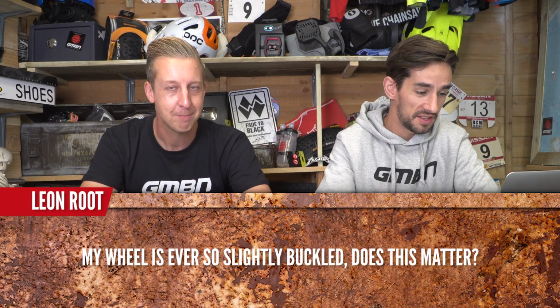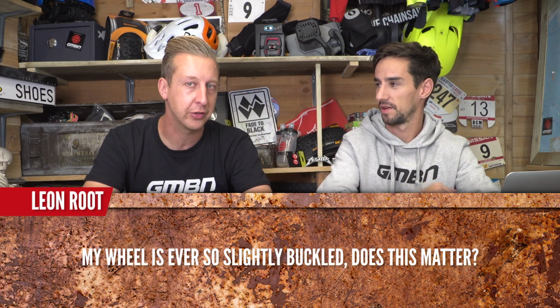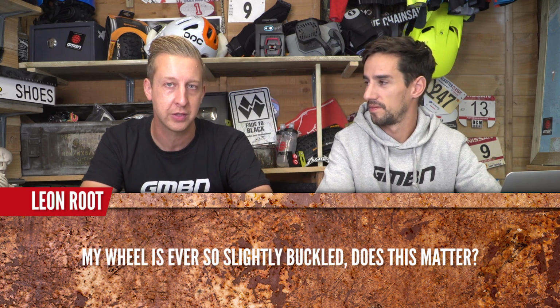Leon Root, my wheel is ever so slightly buckled. Does this matter? No, but you probably should check if you've got any dramatically loose spokes. If the rim itself is damaged, you can just run it until it's killed, really. But check your spokes aren't loose, and you're good to go. You will lose a little bit of grip if it's really wobbly because your tyre's moving around, but yeah, it doesn't really matter. That's it for the quick fire.